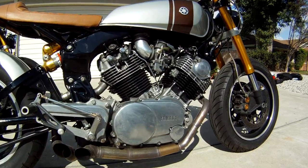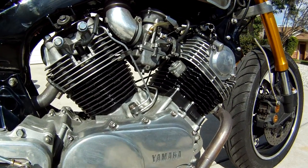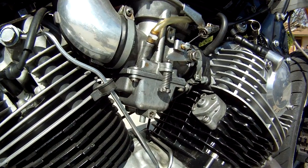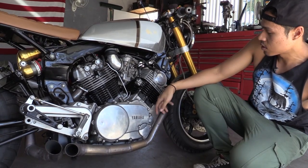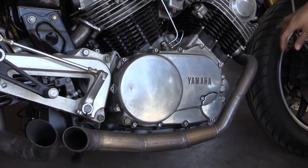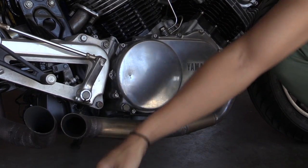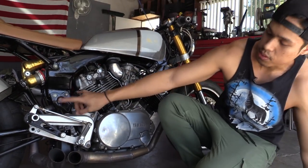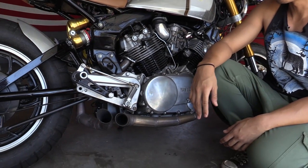This is a factory 920 bike. We bored it out to 980, got bigger pistons, bumped it up a little bit. We went with the stock carb, just jetted it. This is a full stainless steel exhaust I fabricated — it's two separate pieces. The front one stops over here and it's separated. With the rear, the pipe goes down and it's not connected at all.